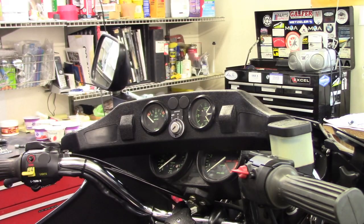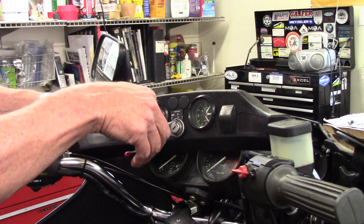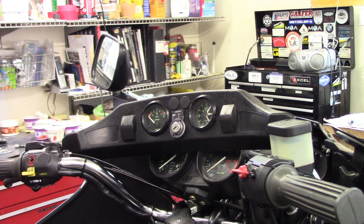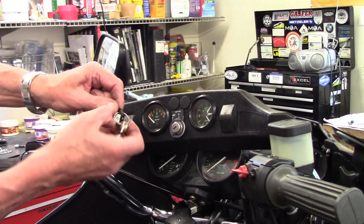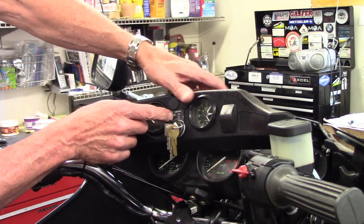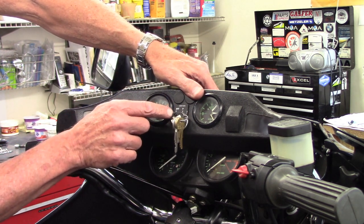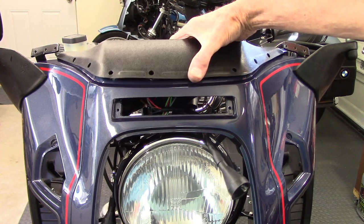I've got the locking ring snug. I like to use a real set of long thin needle nose pliers — stick them into the two holes and then snug up the lock ring. You don't want to get too hard on that because you'll crack the plastic dash. The other thing to confirm is that the pointer is at the right position — the pointer should be pointing to off. There are two slots on the ignition, so I've used the right slot so the pointer on the key lines right up with off.